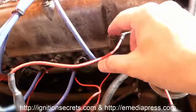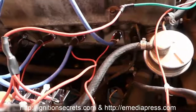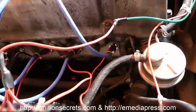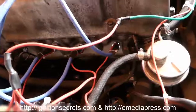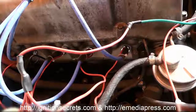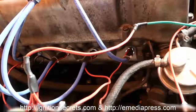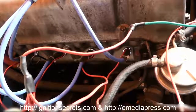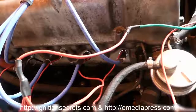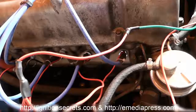And so what I'm going to do is somewhere in between here to connect and disconnect the diodes, probably right here, I'm going to insert some type of maybe 12-volt latching relay. So I just click a button, and I'm only going to turn the plasma off or on when the engine is off, because I don't want it to try to spark through the switch. If the car is off, I can hit the latching relay in one direction, and it's going to open a circuit and keep it there, and the latching relays won't draw power after it makes contact. To engage or disengage, I switch it in the opposite direction, and it'll move the points the other way and close it up. And so that'll probably be the way that I can simply turn the plasma off and on and do comparisons that way.